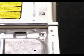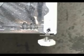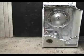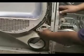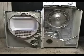Install the side panel and install all the screws. Install the leg on the back, the screw on the bottom, the leg on the front, and the remaining screw. Set the front panel in place and secure it. Connect the door switch wires and install the plastic guard. All you have to do now is install the drum, the belt, the front panel, and top panel, and you're done.